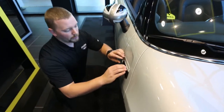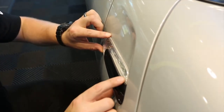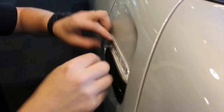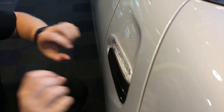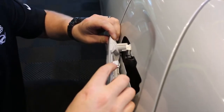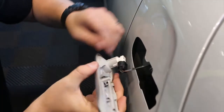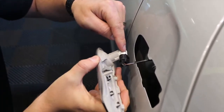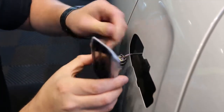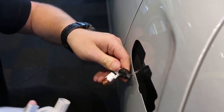To start, we do have to remove the old light and side scuttle attachment. What we do on these cars is take a swift grip on the top and kind of pry downwards a little bit and out — just like so. As you can see, there's a little spring clip here that keeps it in place. After it's nice and loose, we then have to remove the bulb socket from the lamp. What we have to do is move this tab over this little hump here, so if you give it a nice little quarter turn, it will then come out of place.